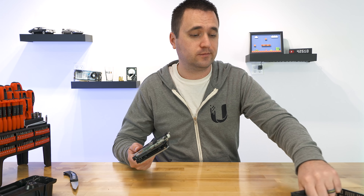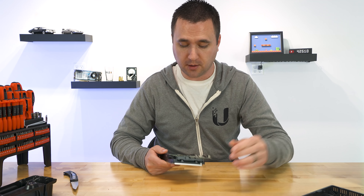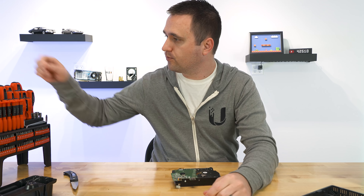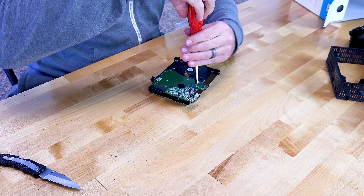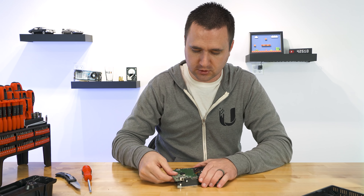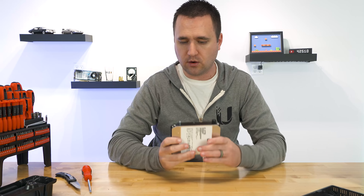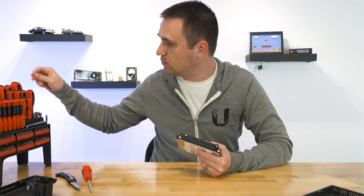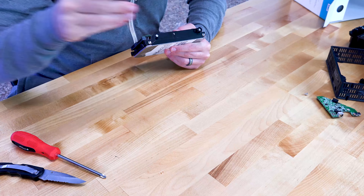Just one of those things, right? I didn't really plan on returning it or taking it back. In fact, I've been sitting on this drive for a while, so probably outside of my return policy as it is. Removing this little USB adapter for the SATA ports is pretty simple — usually it's just one little screw, a regular Phillips head screwdriver. Take this screw out, pull this out and boom, good to go. Now on the sides here, these are where you have the Torx screws, which are a little bit different, so you will need to find something that's going to fit.